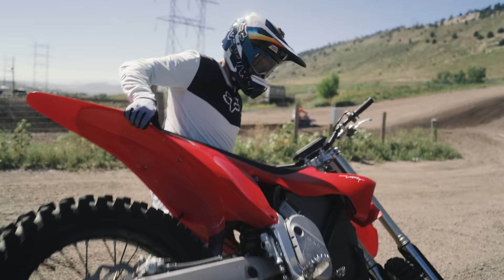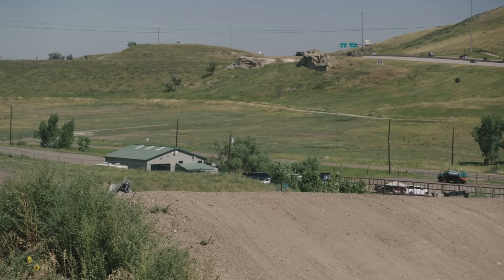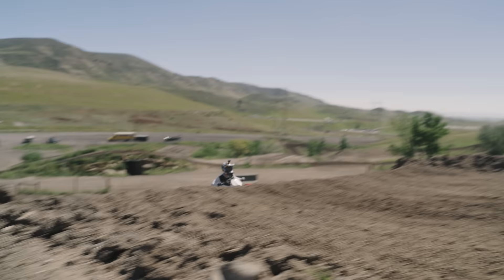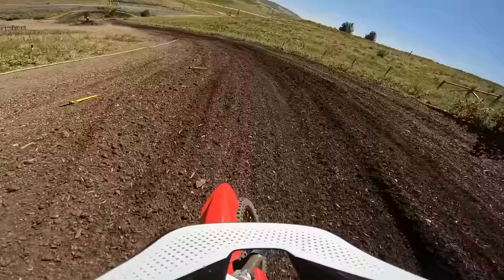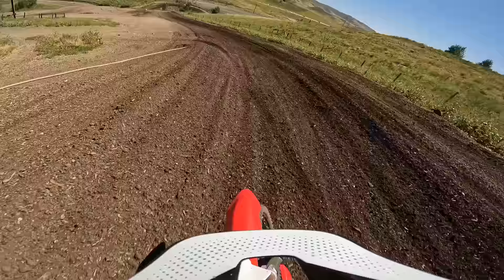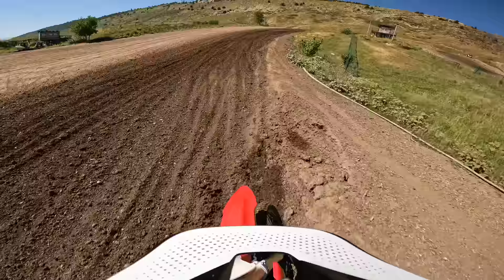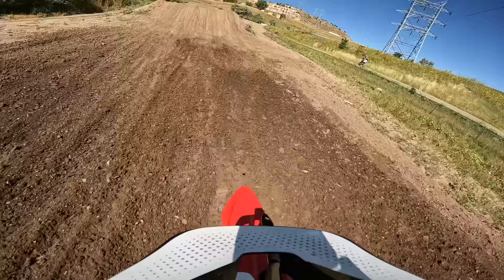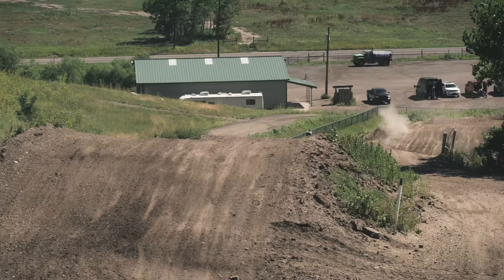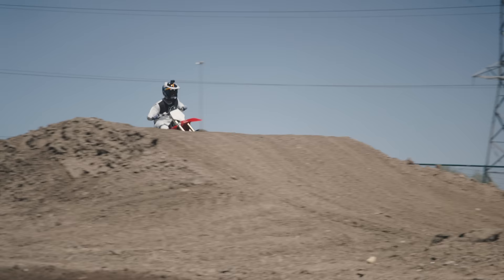We ran some casual range tests when testing the bike at the motocross track. In this session we're at Thunder Valley MX with test rider Derek Anderson at the helm. Derek ran the AMA pro national series for years and has racked up enough pro points to prove that he is one fast dude on a dirt bike. Derek is weighing in at roughly 210 pounds with gear, and Thunder Valley has some solid elevation change and softer dirt. He rode the bike primarily in 50 horsepower with a couple stints in 40 horsepower, both with 50% engine braking. Including some quick stops and a few cruises on the water truck lane — which is common for a day at the track — Derek went 18.2 miles for a total of 56 minutes of ride time before the battery started to show its fatigue.